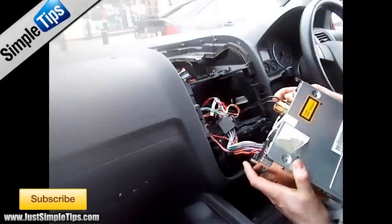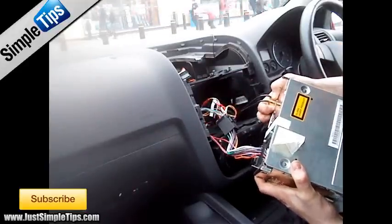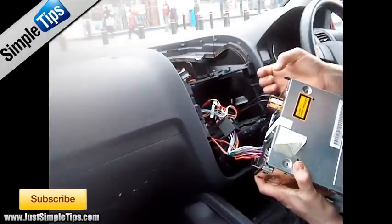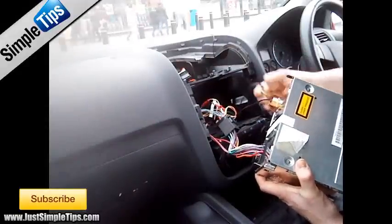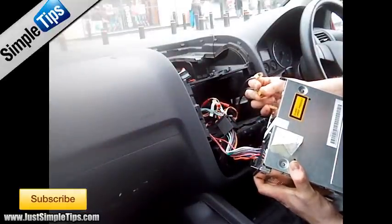The aerial can either be one or two Fakra connections. If it's a pair, it can either be two single connections like this one, or one large connection with two aerials in. They all work the same way — there's a small button to press on the very back end and you slide them off. Be very gentle with them as you can damage the cable.